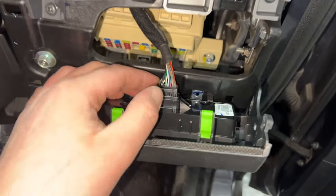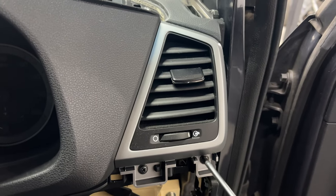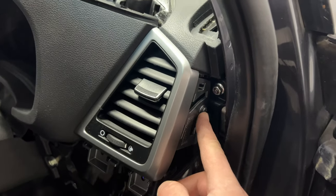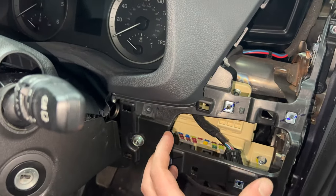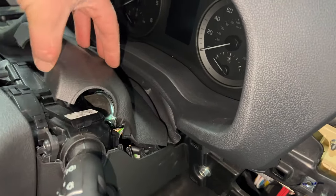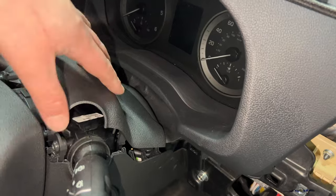More trim clips holding this on, and literally one black plug for the buttons. I'm just going to quickly remove the driver's air vent — same again, two Phillips screws, and then one just here on the side, then this air vent will pull out. Once you remove the lower piece and then the switch panel, it exposes one screw here. There is also one trim you need to remove: the upper cowling for the steering column. There are no screws holding this top piece on — it literally just clips on. Just gently pry up and it will pull off.